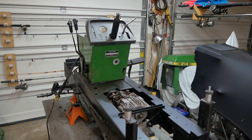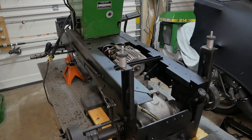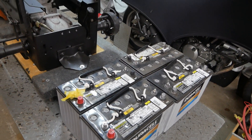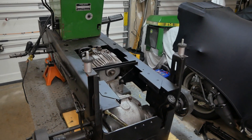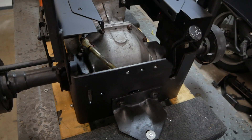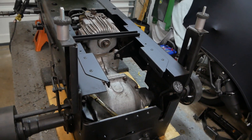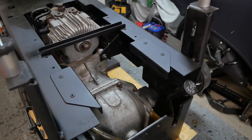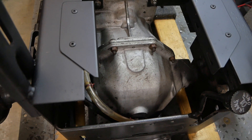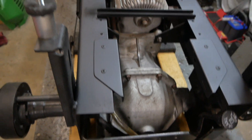Today I built all of the mounts for the batteries. In my last video I was talking about whether the tractor was going to run on 36 volts or 48 volts, and I just can't fit four batteries — I tried a hundred different ways. If I decide I want a fourth battery, I'll have to weld up a box on the back, a doghouse, to hang a battery there. I want that extra weight over the drive wheels. One battery will sit right here on the rear differential with a rubber pad under it — we'll have to see how hot that differential gets.